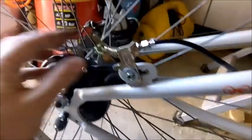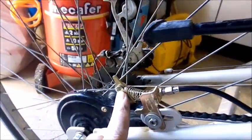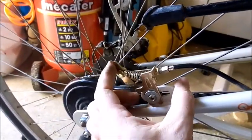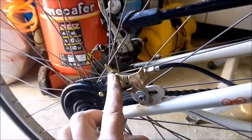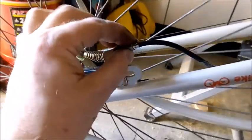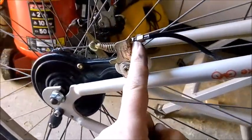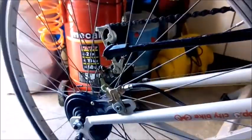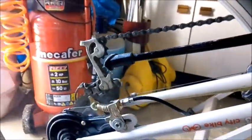That's tightened up. We've got this bolt holding the cable onto the bracket — this is the actuator arm. You want to make sure that's good and tight, and then you'll want to adjust these to hold the cable so it's already slightly under tension. You can unscrew one and lock it off with the other to hold it in the right place. Give it a little spin — there you go, wonderful. Perfect.